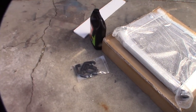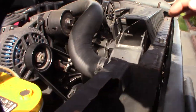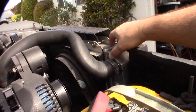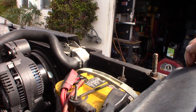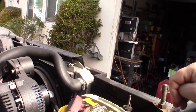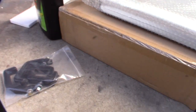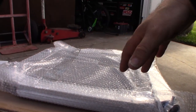I also got some new mounts. I think it's actually one of the issues I had — what actually led to the radiator breaking apart — is that I had it fixed mounted. So I think it was picking up a lot of vibrations. It's on the top, fixed to the thing. Originally I didn't have these mounts like this. Your standard typical Bronco mount is not going to fit this aluminum radiator; it's thicker this way. These were 40 bucks on eBay too, so they weren't exactly cheap, but I'm hoping they will make this radiator last longer because it won't be getting so much vibration — dampening the vibrations.